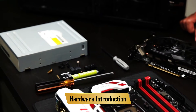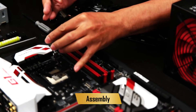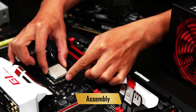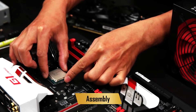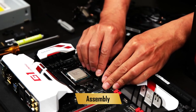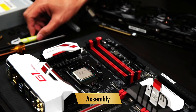Janice, what's first? The first step: we will put the CPU, memory, and the cooler on the motherboard. With the CPU, you have to be very, very careful — it's quite fragile. You open up the lever first and place the chip onto the socket. You'll notice there's a small arrow on the bottom of the CPU; align that with the socket. If it won't go in the socket, don't force it or else you might break it.